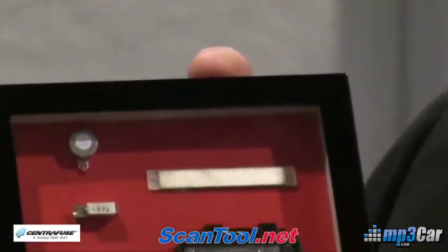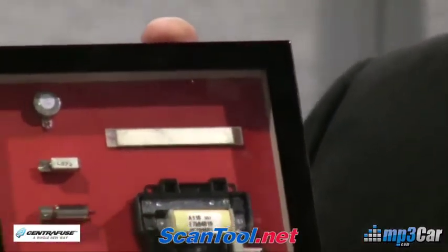What you're also seeing in the picture here are two other devices: a linear actuator used when looking at screens of larger masses, as well as a very thin strip of piezo that is actually creating a pulse across the glass surface of the touch screen.